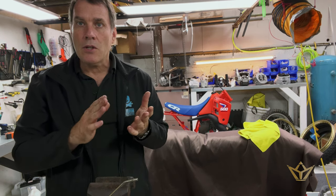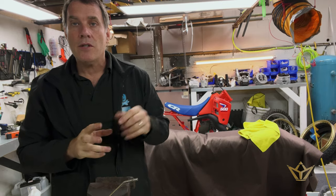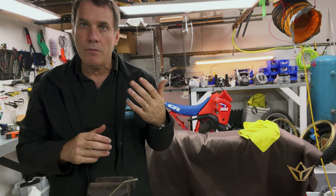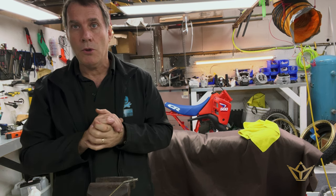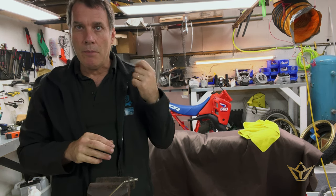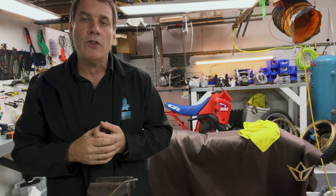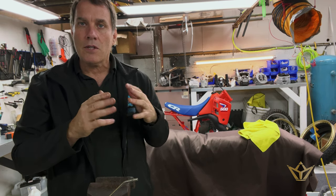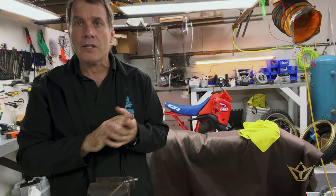With the silica blaster it has made a massive difference to the pace at which I'm able to restore, particularly things like the screw heads and any exposed aluminium parts. One of the lessons learnt which I'm going to transfer over to the Norton Commando is sealing the aluminium. It's one thing to polish aluminium and leave it — it almost goes to a chrome-like finish — but aluminium oxidizes very easily. It's very important to replicate the matte satin finish that is on these bikes as found, and not just polish but also seal them.